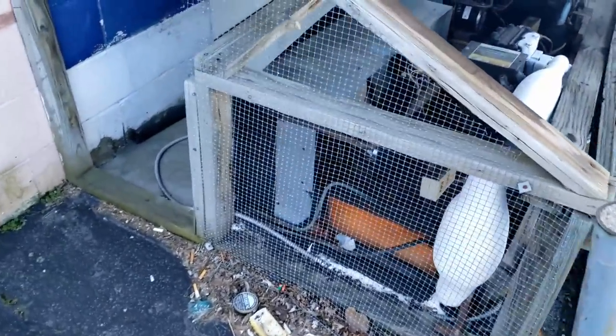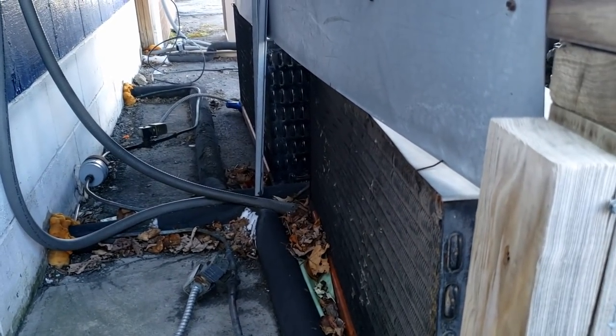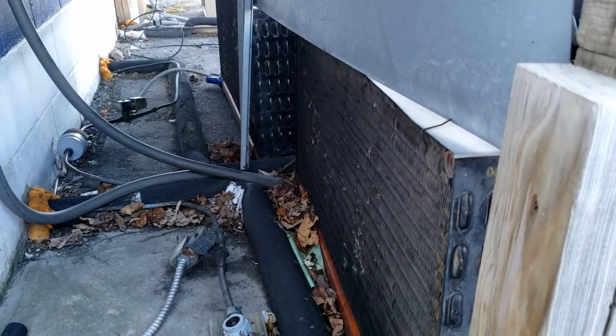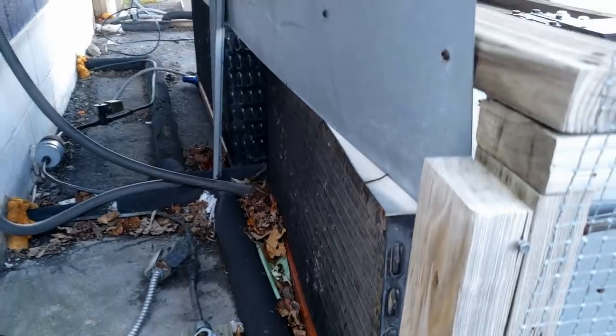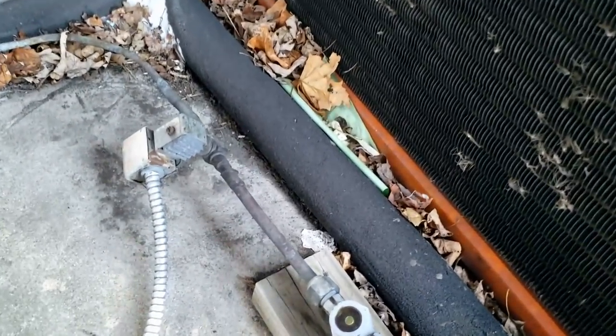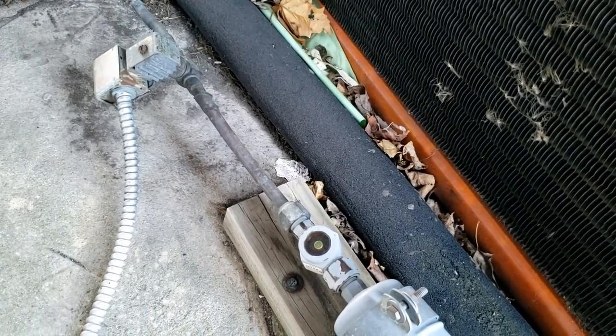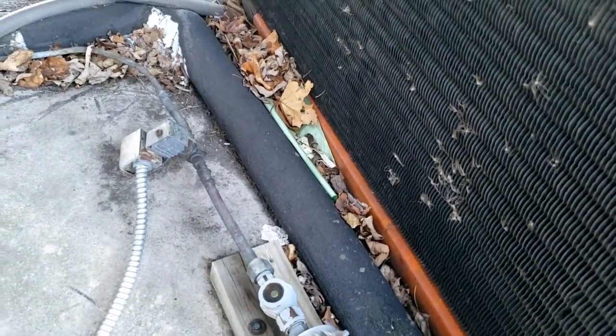This should make for a good video - it did the last time I made one at this place. What we've got going on is the indoor fans on the reach-in freezers - not all of them are working. They had some ice buildup so they cleaned it out with water, now they've got fans that aren't working. Either they pulled things loose or whatever. If you're not running fans you're gonna have bubbles.